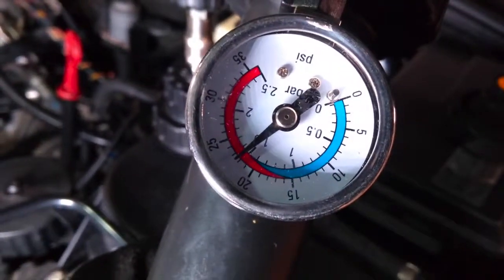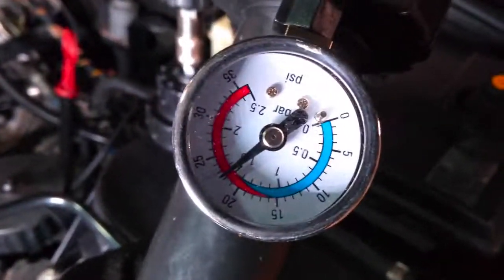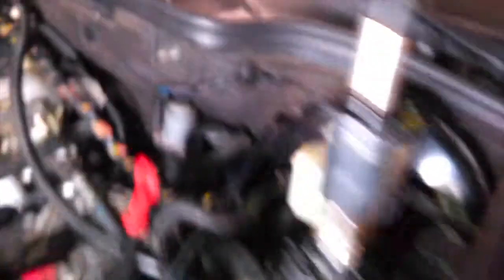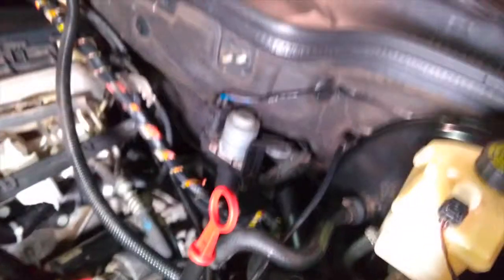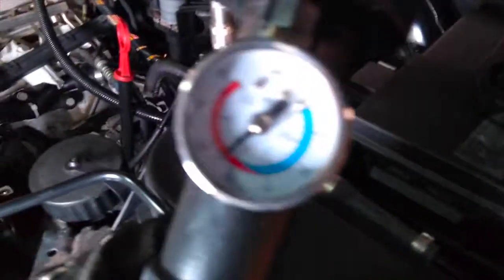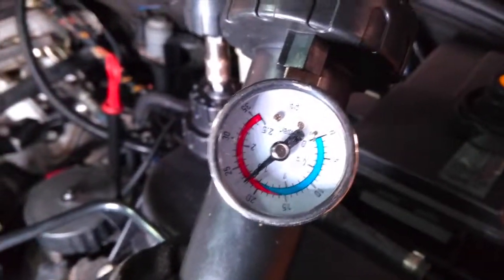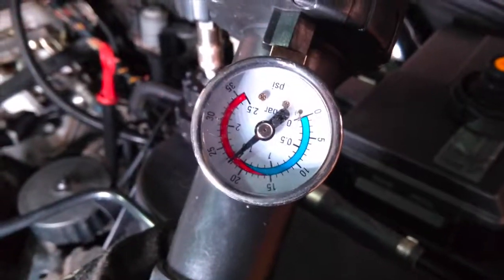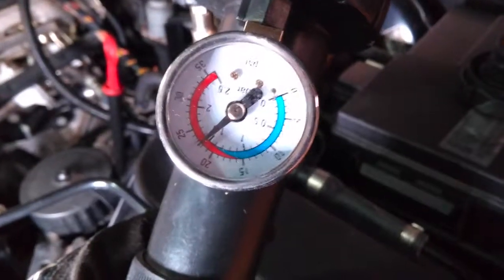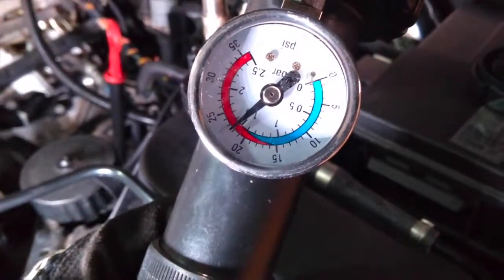We've made it to actually a little over 1.5 bar, or about 22.5 PSI. So the system is pressurized. I don't hear any leaks and I don't see any leaks coming from the water valve for the heater core. That seems to be buttoned up properly — it just required some extra torque on the fasteners. Turns out one of the clamps for the hose I didn't actually tighten down all the way. But that's why we do this test, right? Right now it looks like it's holding this pressure pretty well.